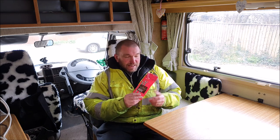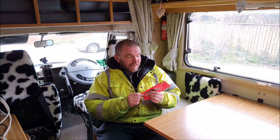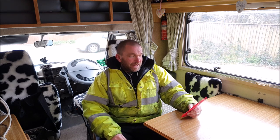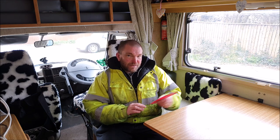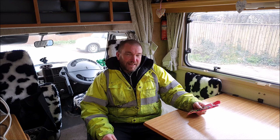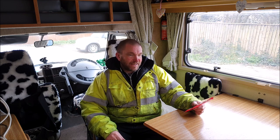So I have obtained these. These were listed on Amazon as thermocouple spanners. I had to buy a set, but it has got a 10mm in it. So we'll try that out and see if that does in fact fit. Now, before we seriously try to undo the nut, once we've decided which of these methods we're going to use, I'm going to apply some heat as well, because that is another suggestion, obviously a good suggestion that often helps. So a bit of heat just to expand everything and let the penetrating oil get into those threads a bit more nicely.